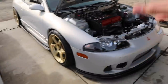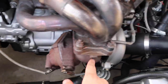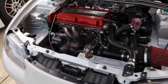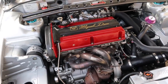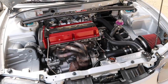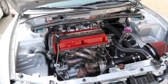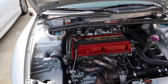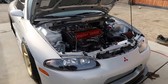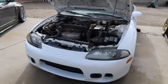When it comes to turbo cars like the Evos or turbo DSMs, it's a different story. You could do the whole thing — change the exhaust manifold, swap out the O2 housing, get a bigger downpipe, and straight pipe the car all the way to the back, because with forced induction you actually need less back pressure, and upgrading to bigger diameter piping gives you a real power increase. For turbo cars I'd recommend going with a three-inch diameter exhaust — cat-back, muffler, straight pipe, whatever you want. I do recommend going with brand names like HKS, Apexi N1, or Thermal R&D — those are usually the best for the turbo models.